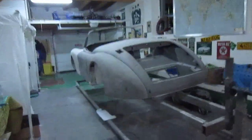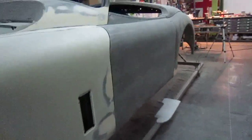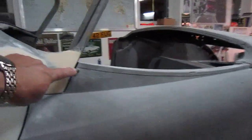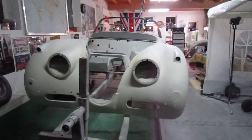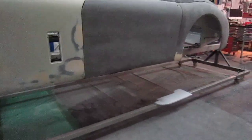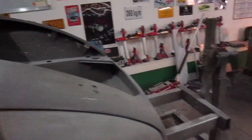Just to put you on to the XK — you can see some of the panels, the door and the rear quarter has been fitted back up, just to see how the line is on the car. It's looking pretty nice. There are some original welds which will be gone over, but what we're trying to do is just see how well the door lines look. There's still a bit of work to do there. We're only at the stage now where we're doing the metalwork. In here, obviously there's a rubber seal which goes between the bolts, so there won't be a big gap.